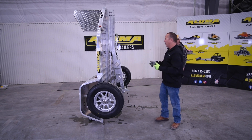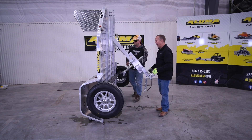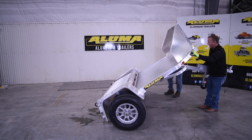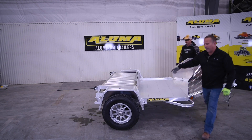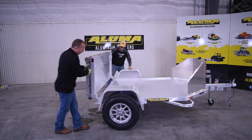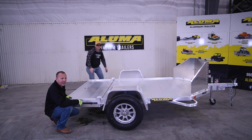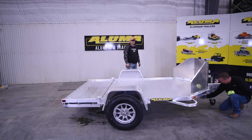To reverse this and set it back down, you just go in reverse. We'll put the jack back down and slowly start bringing the trailer down, grabbing the tongue, and bringing it into place and setting it back down. Then we'll come to the back, release the pin on the driver's side, fold it back down, and not forgetting to secure our pins in the back in place too. They will snap into place at that point. The final step is to make sure that you put your pin in on the tongue.